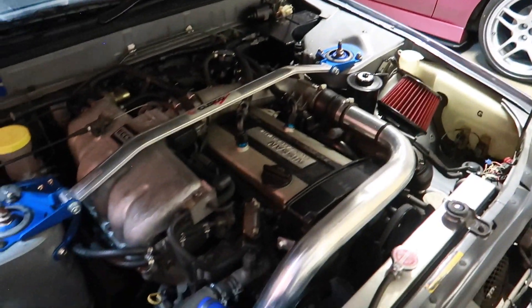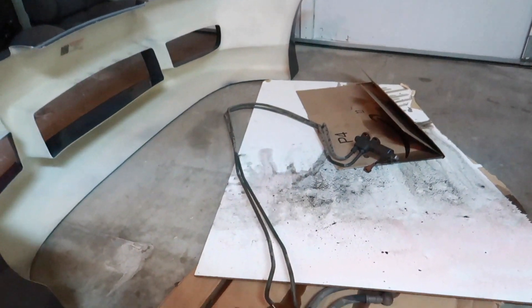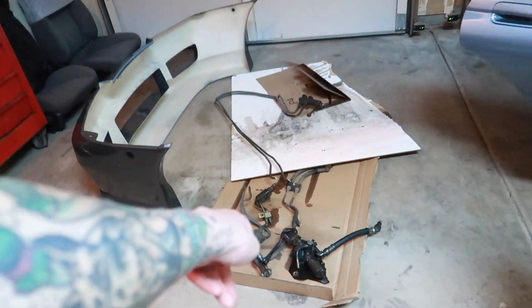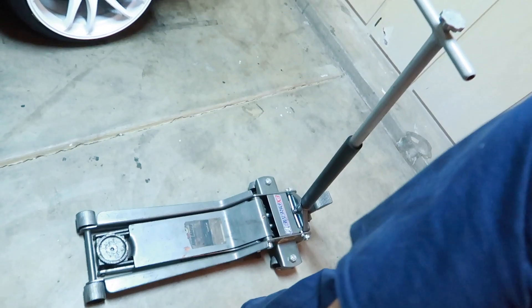Successful uninstall of the HICAS system — this is all the hardware that was in the R32 Skyline, a lot that is definitely not needed, but a good concept. I double-checked all my lines — the top line isn't leaking nor is the bottom line, but I'll check in the morning again for any leaks and continue to bleed out the system. This was very easy to do, very time consuming, but as long as you're somewhat mechanically inclined and have the proper tools and a jack that gets you at least two feet in the air, you can definitely get this done. If you have any questions, shoot me a message in the comments or on Instagram — link in the description. Thank you for tuning in, and remember: aim high, drive low. We'll catch you in the next video — take care.